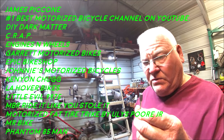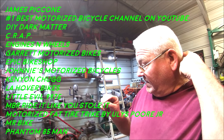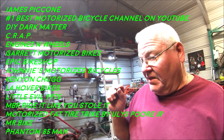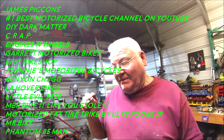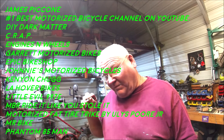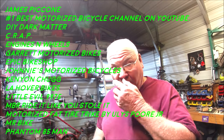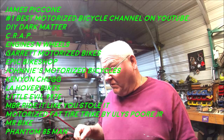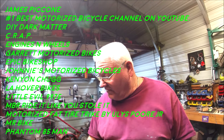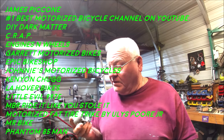So this is one I used. You could spin it in a drill at 12 point something millimeter. I'm pretty sure you can get it in a half inch drill motor. Spin it, work it slowly, and you can get it cut down for a 10 millimeter wrist pin. And then cut it off in half and get the distance you want.